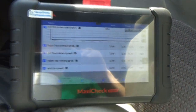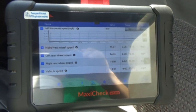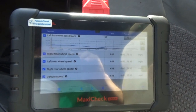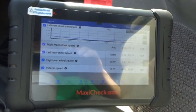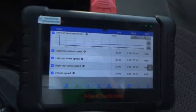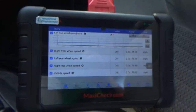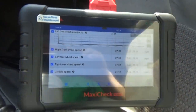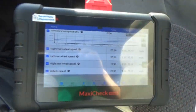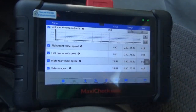When I get to the end of this road, I am going to turn right, so we're going to see if we lose our wheel speed signal. But my guess, now that I think about it, the one terminal on the body harness did have a little bit of corrosion in it. So maybe there's a chance that if that connector is being pulled, or getting snugged up on something while the wheels turn to the right, it's not making good contact with that particular pin. So I should have bought some terminal cleaner, but I did not. But so far, it looks like everything's still pretty consistent.